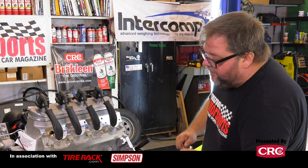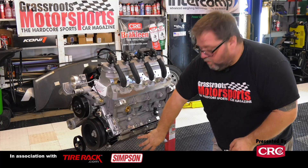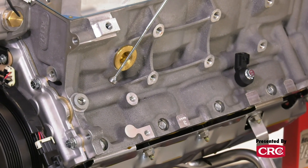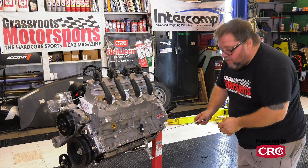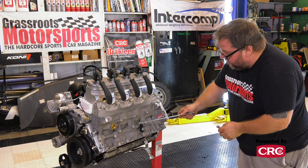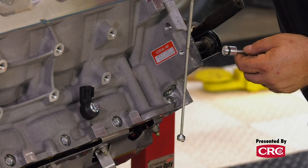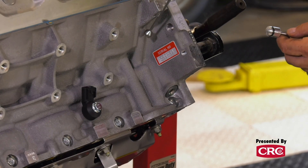Let's trace the path of the oil going through the engine. The stock oil pump is up front on these things. It picks the oil up from the sump — this is the pickup tube — into the oil pump on the front of the motor, and passes it through this passage along the driver's side of the block right here. Now right here is where the stock oil filter would normally mount. Oil passes through this passageway, needs to take a hard right turn at this junction, flow down into the oil filter, get filtered, then flow back out through this passage and on through the rest of the engine.